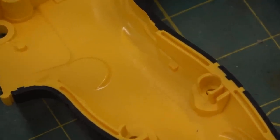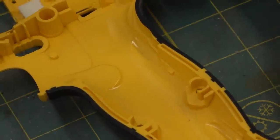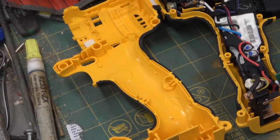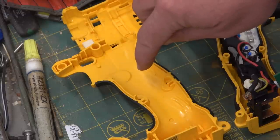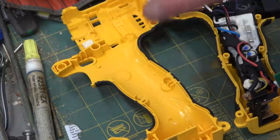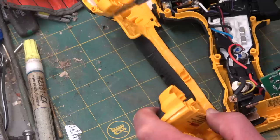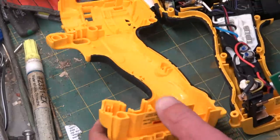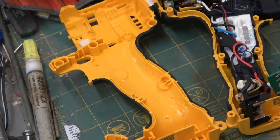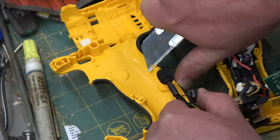The clamshell half is molded in polycarbonate and PBT with SEBS or TBS overmolding — that's the butylene. The PBT is polybutylene terephthalate. CAV2 is probably just the second cavity marking which side of the mold this came out of. There's no glass fiber reinforcing. For impact resistance they've used polycarbonate, which is extremely strong and expensive, possibly offsetting cost due to reduced mold wear without glass fiber. We'll confirm that by ear — no scritchy at all, which you'd normally hear if it were full of glass fiber. That's just straight plastic.